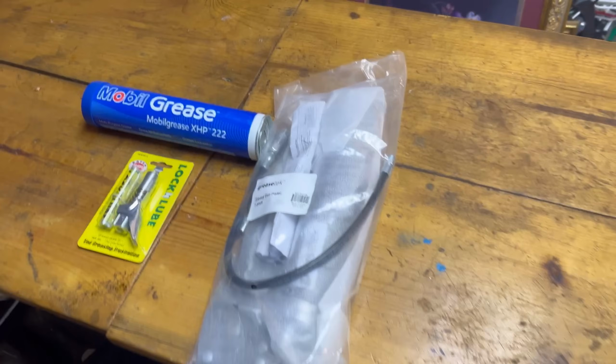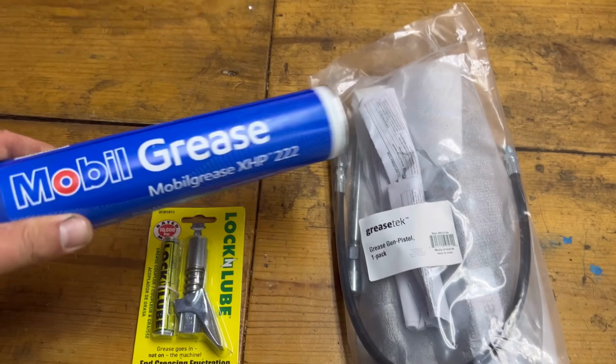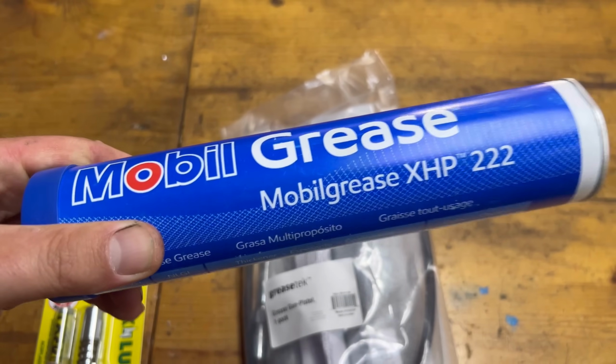Once we have both upper control arms installed, we can now grease the new ball joint with greasable ball joints. So we'll grease those. And also now we can grease the 2 bushings on the upper control arm as well. We're gonna grease the upper control greasers with the recommended grease from JBA.